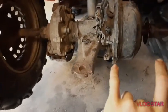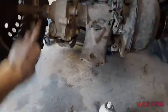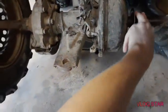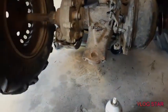As you can see I got the tire off on this side. I've done rear bearings before but not on this particular four-wheeler. Normally one side comes undone and you pull it through, but on these four-wheelers they have axle nuts on both sides. I'm going to start with just taking off one side and see what happens — if I have to take off the other, it's no big deal. This side had regular threads; I'm not sure if the other side is going to be reverse threads or not.